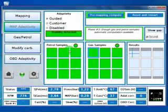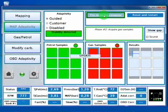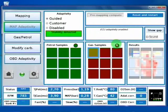Now we have all samples, petrol and gas samples, and we are in phase 3, so we have enough gas and petrol samples, so we can make an automatic computation of the adaptivity map. So we click here, now you see petrol samples and gas samples turned to a darker color, because now they are not so useful for us. We now need to see only the result map, which is the thing we have to take a look at.